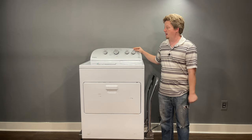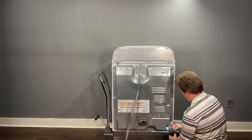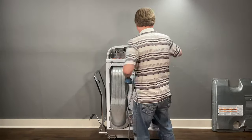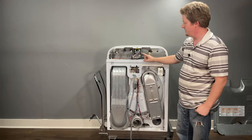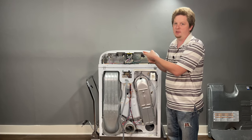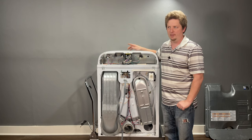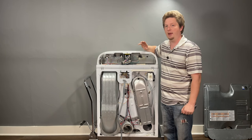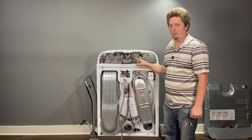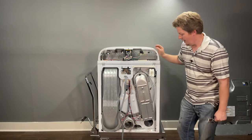The next three issues are on the back of the dryer. Turn the dryer around and unplug it before proceeding. The first is a bad timer motor. Think of the timer like a clock with contact points that turn the heating element on and off. The motor is what advances that clock. If you put it on air-dry and the timer doesn't progress — just stays on air-dry indefinitely — you may have a burned-up timer motor, which will also keep the heating element on constantly during timed drying.